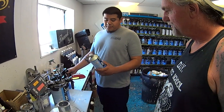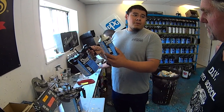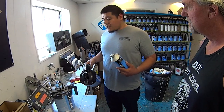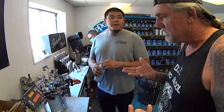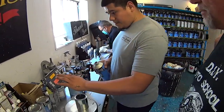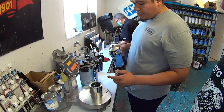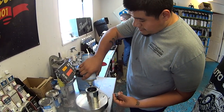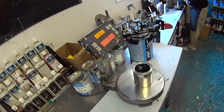What is this? This is what I'm explaining right now. Since we're using this type of enamel here, this is a dryer that needs to go with it. That way, whenever you shoot the paint, it can dry on you. Oh, so that dries real quick? Not as quick as you think, but it helps it evaporate and dry. Okay, so now we've got our enamel dryer. I've never heard of that. There's 20 parts in each quart, so we're going to put 10 parts in the pint. See if I have enough here. If not, I'll get some more in there. Well, you're short 4.1 parts. Go get another one right quick. Okay, go ahead, bud.